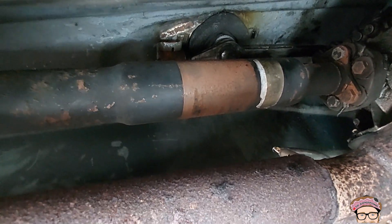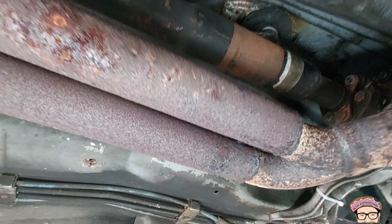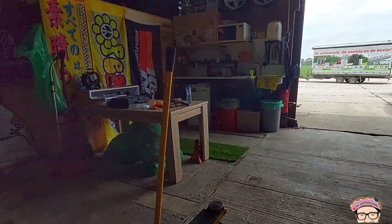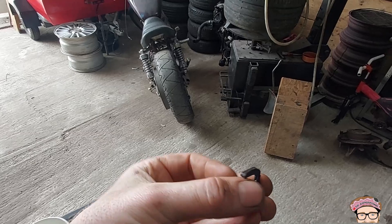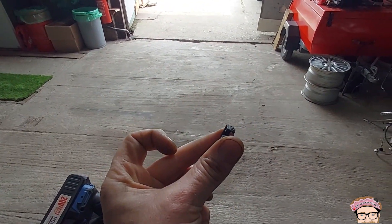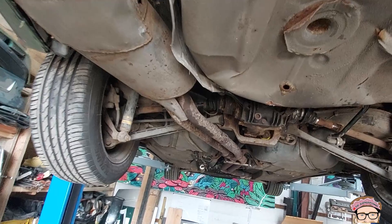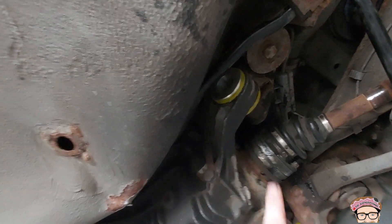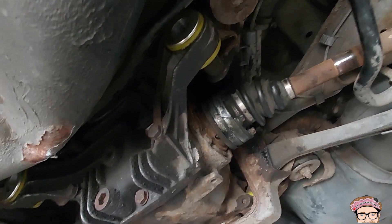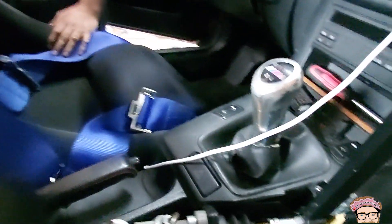You put the nuts and screws in that black circle there, or take the rubber out and put it in that location. So let's start tearing it up from the inside. There's one little clip that sits sideways — you need to slip that off, and then you can undo the bottom shifter linkage. Also, we took the diff out and placed new polyurethane bushes in it. He also had some broken driveshaft bolts, so we put a few new ones in — it should be two-wheel drive again and able to do a skip.